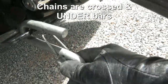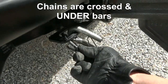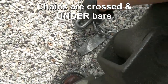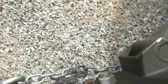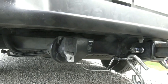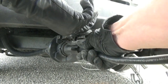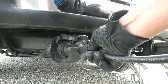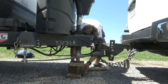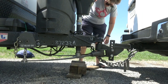We now hook the chains in, and the breakaway cable does need to be attached separately from the chains — that is an important thing and it's required by most states. You'll notice that the chains are crossed, so that should something happen and the ball comes loose, the chains will catch the trailer. The breakaway cable, should the trailer get loose, automatically pulls a pin and will stop the trailer. Important safety equipment. The seven-way plug — you'll notice there's really only one way to plug it in. Secure it and make sure it's good and tight, then always physically check to see that the lights are working, because you certainly don't want to get down the road and find out your lights have not been working.